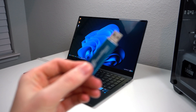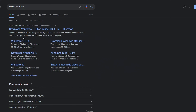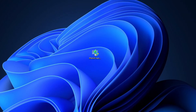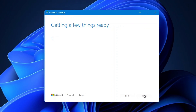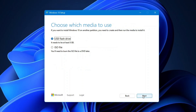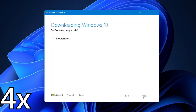To install Windows, get a USB drive that is at least 8 gigabytes and plug it into another computer. Head over to Google, type in Windows 10 ISO, and click the first Microsoft.com link. You can also find the link in the description. Scroll down and click Download Tool Now. When downloaded, run it, click Accept, then click Create Installation Media and click Next. Ensure it's your language of preference, Windows 10 64-bit, and click USB Flash Drive, then Next. Click Next again and it'll take a bit to install Windows 10 onto the drive.